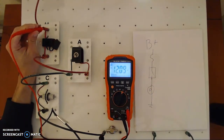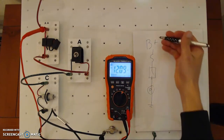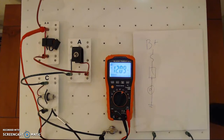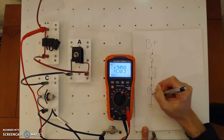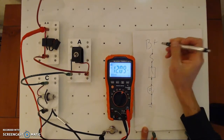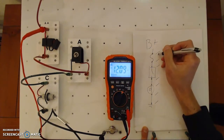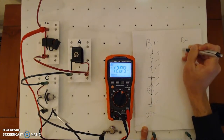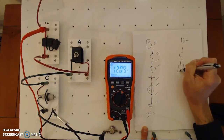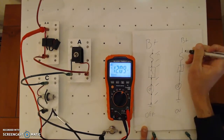Here's a tip I use as a technician: when I have a circuit in front of me, I want to write down what I'm expecting. We have test points before and after each component and down at the bottom. At each of these points I'm going to draw what looks like a fraction. Underneath each point I write down what I'm expecting. Here I'm expecting 12 volts — we'll call this 'circuit off' — and then over here we'll draw another circuit for 'circuit on.'